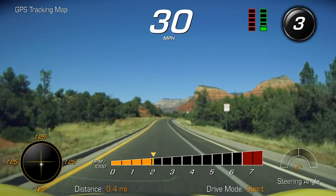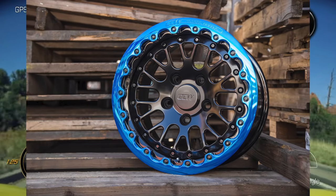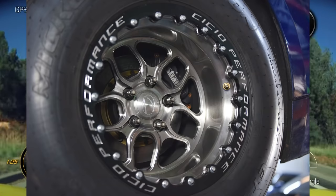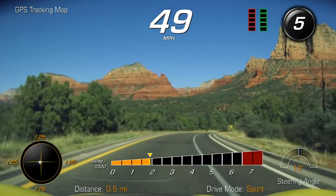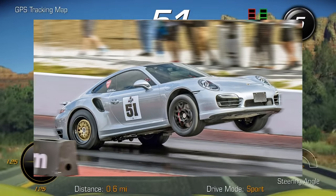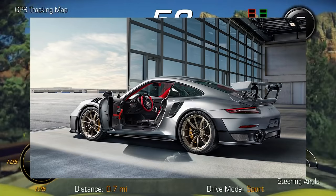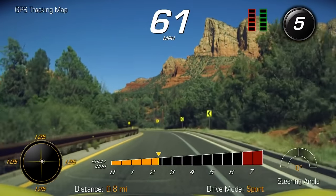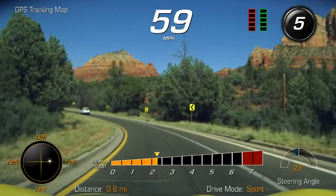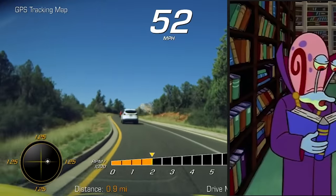Brands like Mickey Thompson's and Nitto's are popular, especially with bead locks. Bead locks are basically multi-piece wheels designed to prevent the tire from deforming under hard acceleration. The whole point of having smaller drag wheels is that you actually want a larger sidewall when going fast in a straight line — very counterintuitive to track racing, where you want less sidewall for stiffer, more rigid cornering.